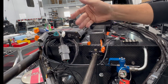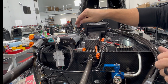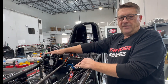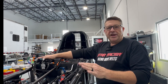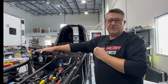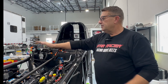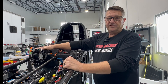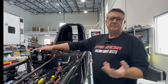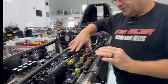This controls our timing. I've already got the power and grounds hooked up. We have a system where if the car doesn't have air pressure, it does not allow the timing to come on — it won't get a signal and will not have fire. So if you blow an airline going down the track and lose system pressure, it can lean the motor out because it controls part of the fuel system, but this will catch it beforehand and shut the car off. Losing air pressure means losing voltage to this system, which shuts the car off — which is a good thing, because otherwise it would probably destroy a motor worth hundreds of thousands of dollars.